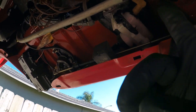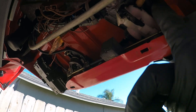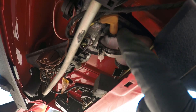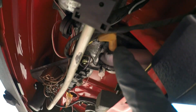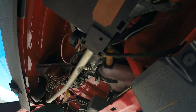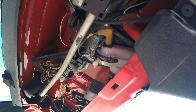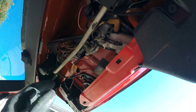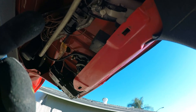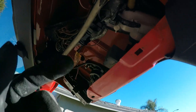Or just from age, the vacuum hose — which goes here through this 90-degree elbow right there — will develop a small leak. To solve this issue and keep your vacuum pump from burning out and running down your battery, because it's trying to endlessly lock the car: it will keep trying to lock it until it actually gets a signal from the micro switch that says it's locked. And if there's a vacuum leak, it'll just keep doing that.